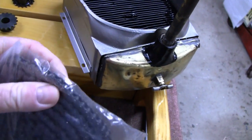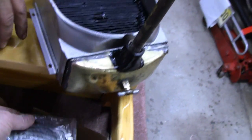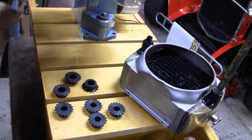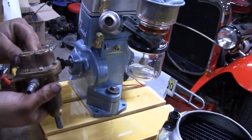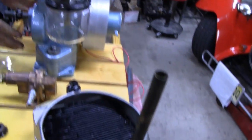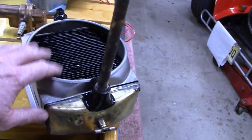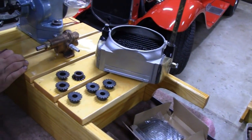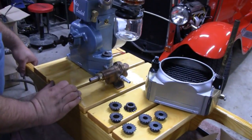There's not a lot of power being transmitted either. Plus it's only a 25 chain — it's not like it's a big Harley. And the pump is quiet, so you don't have to really worry about that. So what we're going to do now is bolt the engine down where we want it — that's going to be our reference, we'll go from there. And then we've got to make a mounting bracket for the radiator. Good deal buddy, good plan.